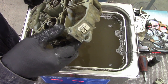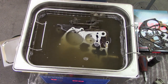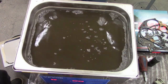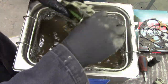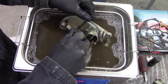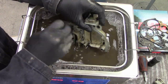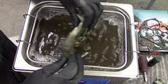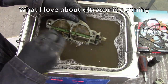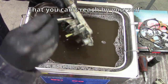This is my first time doing ultrasonic cleaning with a carb. I bet if you got in there with a little acid brush, you could probably do okay. I later got rid of the basket — it didn't really fit all that well. The bottom I ran for about an hour to an hour and a half, and the top maybe 30 minutes to an hour. It sure came out pretty nice and clean. I just got into the nooks and crannies with an acid brush to see how well it was coming clean. You just don't want any debris plugging air passages, ports, or jets. I had a couple squirts of dollar store dish soap in there — if it can do dishes, it's probably good for a carb.